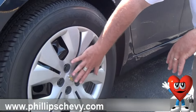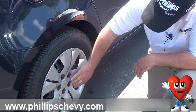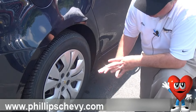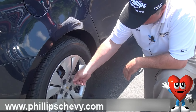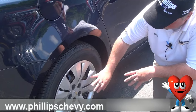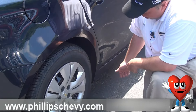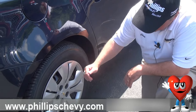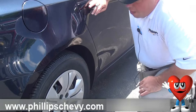Now when you put the spare tire back on, you want to go opposite sides — so you don't keep going and put one nut on all the way tight, because then you'll never get it on evenly. Basically you do one, give it a spin, go across, do a spin — kind of like a star pattern is what they call it. So you keep going back and forth until you have everything very tight. Make sure it's on there smooth and easy. Then you're going to carefully undo your jack, bring the car back down to the ground. When you do that, recheck your tightness to make sure you have all the nuts on very tight. And then you'll have your spare tire on.